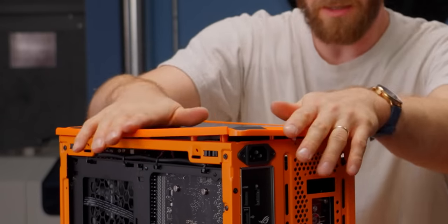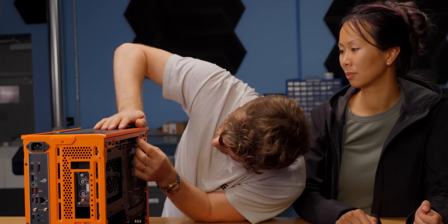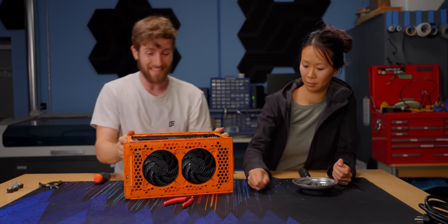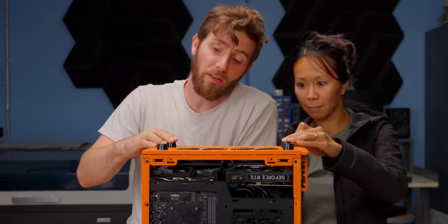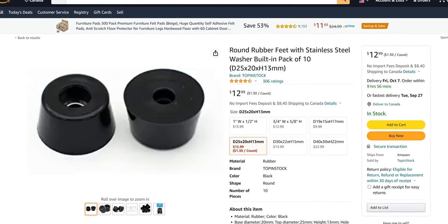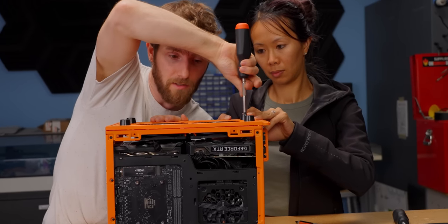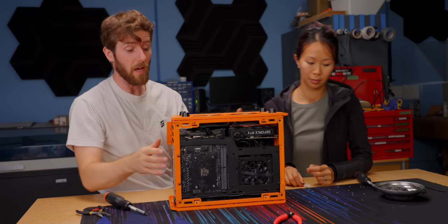Both systems should be powered on to ensure both will be adequately cooled — those fans are basically just providing intake air for the GPUs. They completely block off airflow from any other part of the system, which means when it's time to install our slim fans on the second panel, we want those as intakes as well, then counting on the open ends of the case to passively push out the extra air. This time we get to keep our mesh, which is a little nicer for keeping dust out. The bottom needs feet because otherwise these fans won't be intaking much of anything. These little rubber feet from Amazon are 13 millimeter tall and available for just a few bucks. One thing I'd like to do if I did this again is add some mesh filters to help keep dust out.